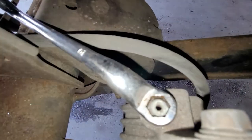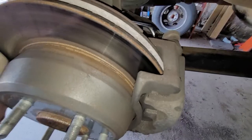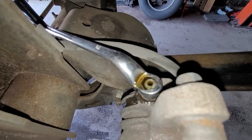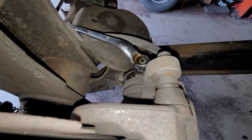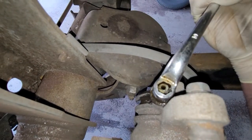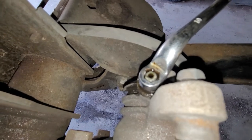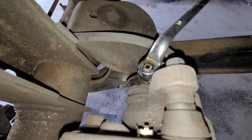And I got nothing — this thing is still locked up solid. See how it's even moving like that? You know it's not locked up on the brake shoes. There you got some fluid dribbling out — that's normal. I'm pretty confident now that we just have a bad caliper. If there was a restriction in the hose, the hose is acting like a one-way valve or something like that, then the pressure would be in the caliper. You crack the bleeder free and then it would spurt out, and then the brake itself would actually release. So since I don't have that, I'm pretty confident it's just a bad caliper.